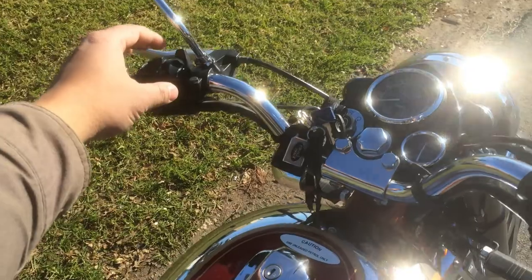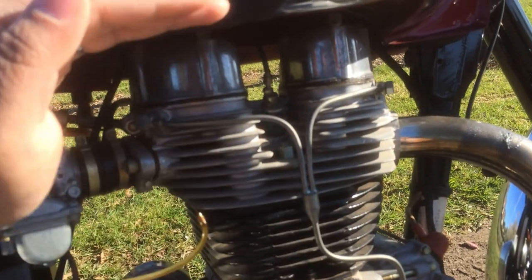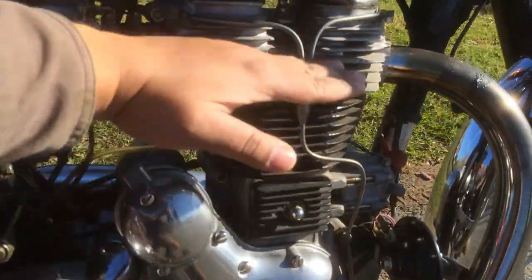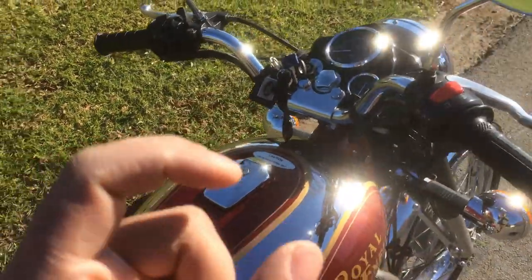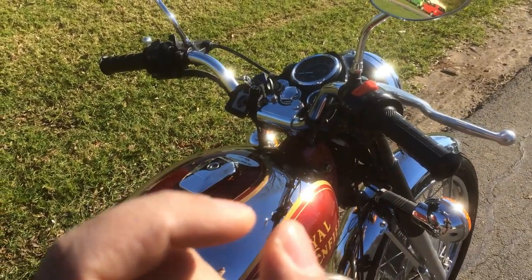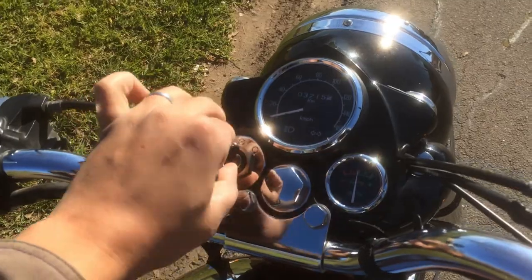That's the decompression lever and that's the decompression valve — pulling that releases pressure from the top of the cylinder. This bike doesn't have electronic ignition or CDI; it has a points system. Once the piston was at top dead center using the kick lever, the amp meter would sit straight in the middle — that's how you'd know the contact points were in the right position. Otherwise it was much more difficult to kickstart, and you could often get a nasty kickback that would hurt your legs.